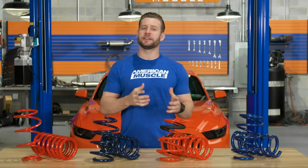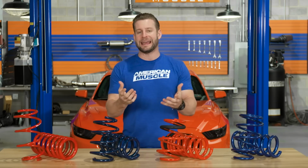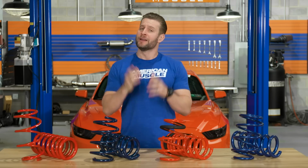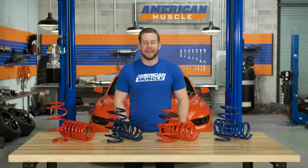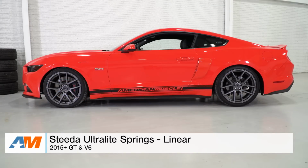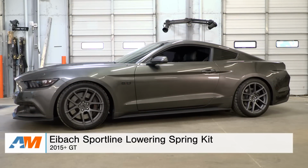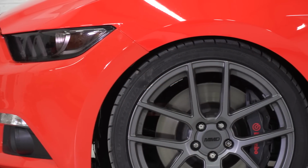Now the purpose of this video is just to give you my top picks here over the last few years working at AM, in addition to factoring in some customer feedback and reviews as well, to hopefully make your life a little easier when it does come time to lower that new Mustang. And after all, that is the purpose of this video, to lower the ride, get rid of that ugly factory 4x4 ride height, which can be a benefit for two ways. Obviously, it's gonna look much better, but in addition to that, it's also gonna help your handling performance thanks to that lower center of gravity.